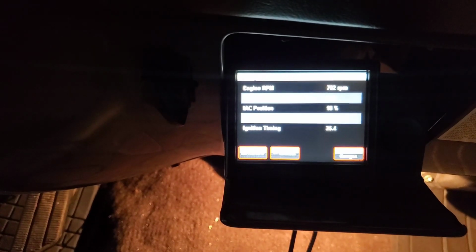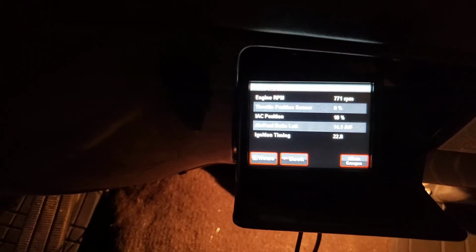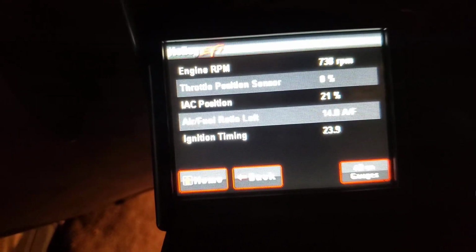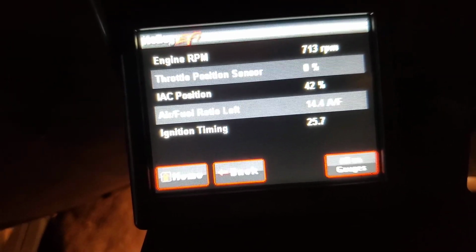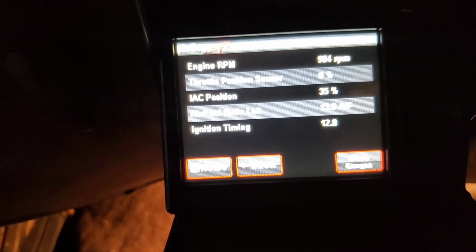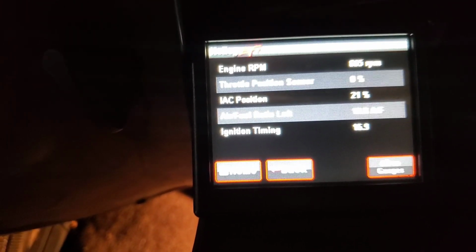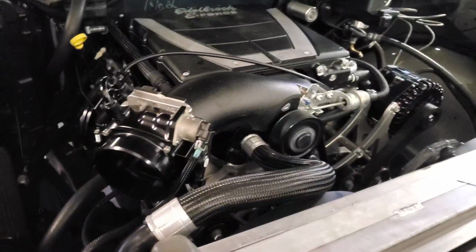That bumps it up to 20 on the initial engagement of that compressor, brings it back down to 17, 18. AC is blowing nice and cold. So I like that on the idle air control. Still 0 on throttle position sensor. Put my foot on the brake, put it in reverse because that's the closest gear, and now we're in 35 to 40-ish. So that's all tolerable on the idle air control. And then, as we put it back in park and we shut the AC off, that idle air control will slowly creep down to 10, and then it'll really creep down to like that 5% zone. So right where we want to be.